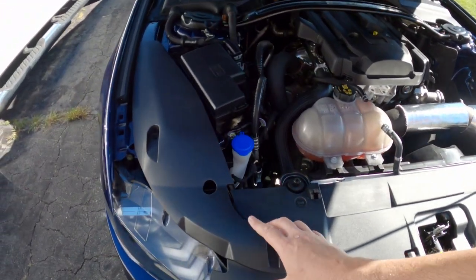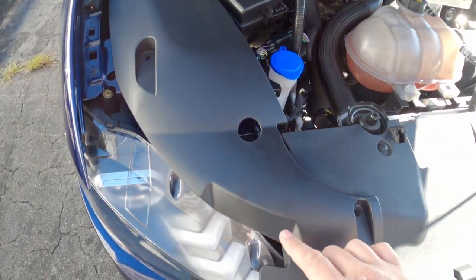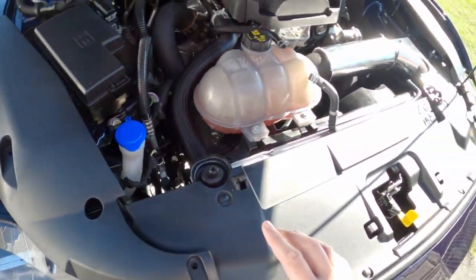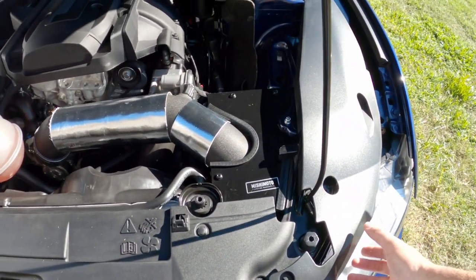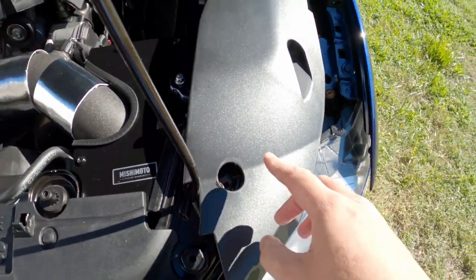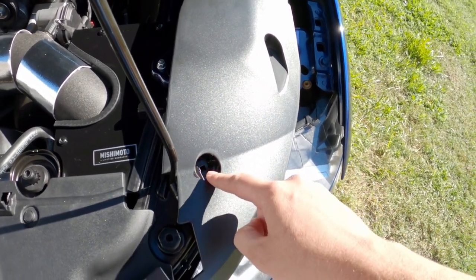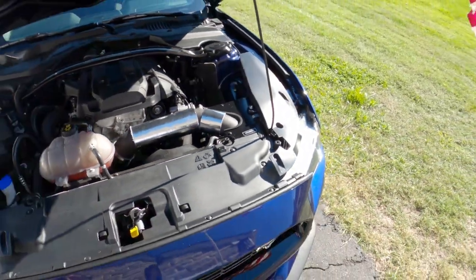Not this one, but this one. I know that basically all I have to do is just move the hole where the hood stopper is, which is a little bit further down. This side isn't so bad, but what I've noticed is to install this, the hood prop has to actually kind of go through this hole and I have to make a little notch right here for it to fit. So that's the only thing I have to do on this side, as far as I know. Pretty easy modifications and theoretically they should fit.